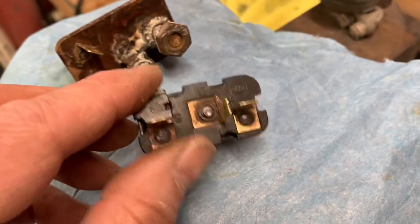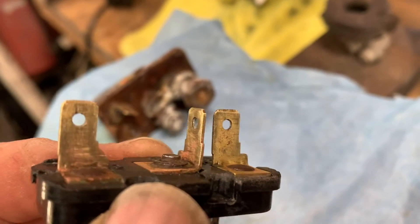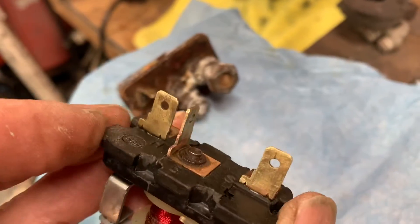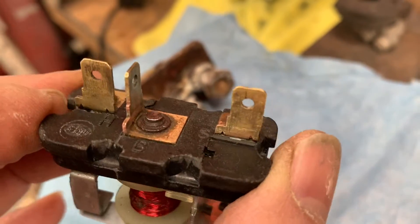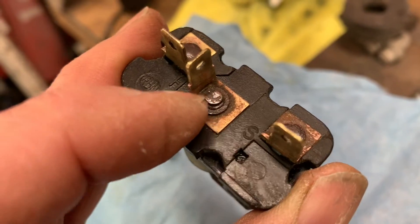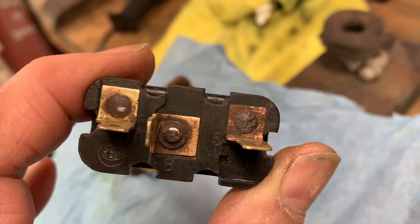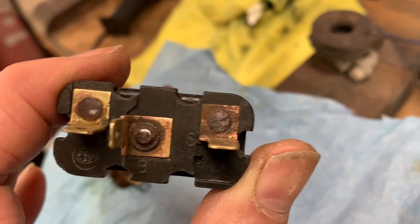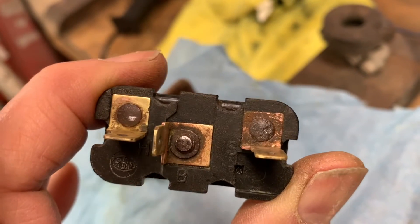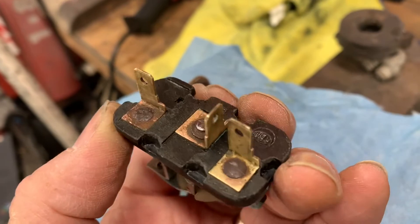Here's a horn relay I had worked on. I had already started to use a little sandpaper on the terminals, which is actually what gave me the idea to try the Brasso — because I got tired of sanding and sanding and realized I wasn't getting it as clean as I wanted. The wire brush wasn't cutting it either. The Brasso did a pretty good job. I need to hit this again to get it a little better, but see how well it worked out.